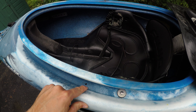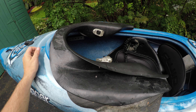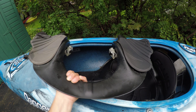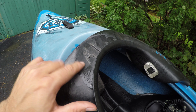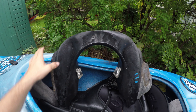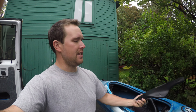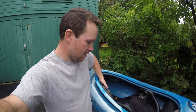For starters, by pulling out the smaller screw in front of the seat bolt you get this entire thigh hook plate - both thigh hooks are incorporated into one. I noticed on mine there's an 'A' labeled in. I've heard rumor that one set had the legs going basically straight and the other gave you more of a modern knee bend. This is a modern contour thigh hook, and using the slot on the back side in that screw hole, I simply toss this in and dry fit it. That was the immediate cure to all my ergonomic issues.